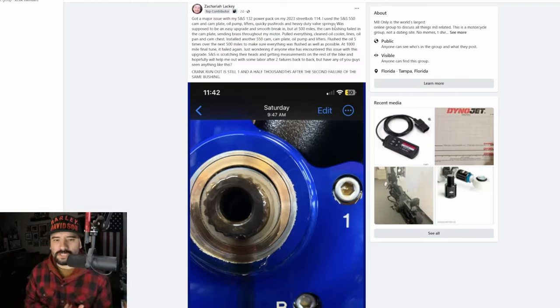So you have the 475, which they're called drop-in cams. Anything below 500, you could drop in without changing your valve springs. So this is why he had to go ahead and put in heavy duty valve springs. This is just something that you have to do with the Milwaukee 8. Harley's using inferior valve springs.